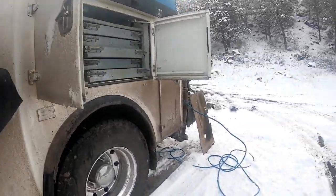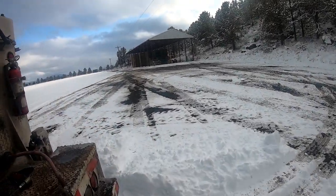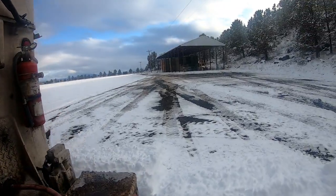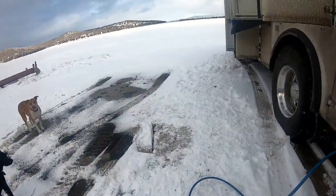You let it down, then you play with the valve, and then it goes back up. Something in that valve is not acting right. Might have to pull it back apart and completely strip it and see what's going on. I'm going to call the hydraulic shop and talk to him about it too. See if he knows, has any ideas what might be hanging up.